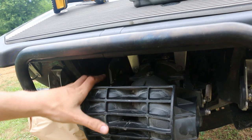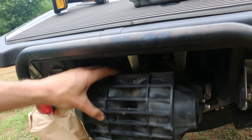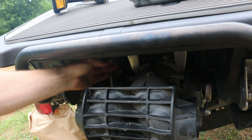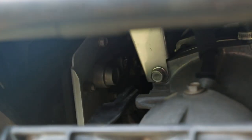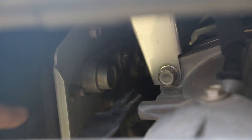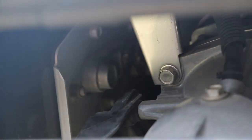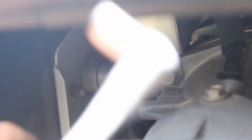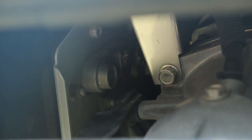As we move to the back of the jet ski, in order to remove the actual RIDE motor assembly that's bolted on from the outside, right back here we can disconnect this arm. Let me zoom in a bit — back in here there are three nuts and some bolts. These are all 12 millimeters. According to the Yamaha instructions, you have to remove the whole jet pump, the ride plate, and pick the jet ski up. But I really think we can get in here with a 12-millimeter socket on a quarter-inch ratchet, because this is pretty small. Let's see if we can get these loose.